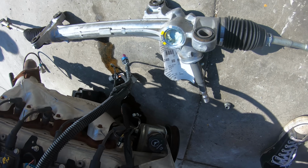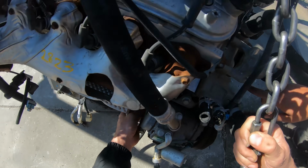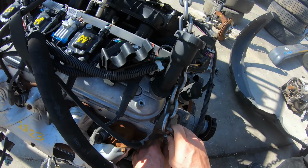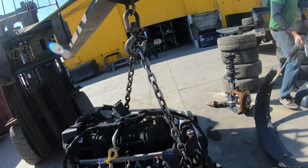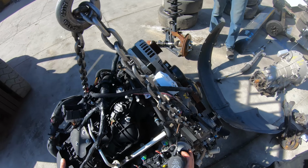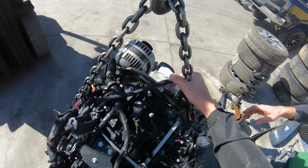Now, what about the transmission? I obviously can't use the same transmission or the same transfer case, right? Absolutely. So, 2012 and up utilizes the WA580, which is a Mercedes-Benz 7226 platform. It'll handle 550 horsepower and 500 foot-pounds of torque right out of the box with no modifications. So we've built an adapter that'll bolt the 5.3, the 6.0, or the 6.2 directly to the WA580.